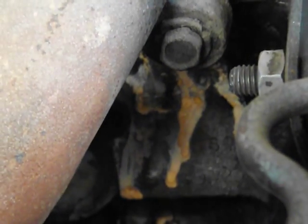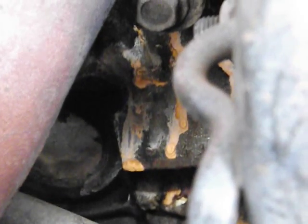See like coolant running down the side of the block. Now, it ain't a Welsh plug, and the reason why I know that is because the Welsh plug is below the rusty mark on the engine block.